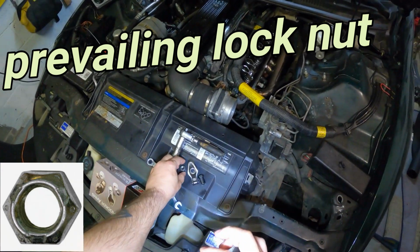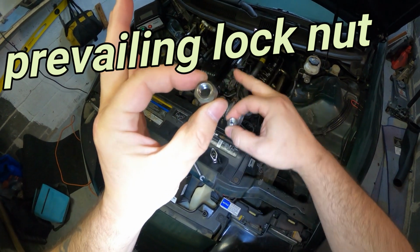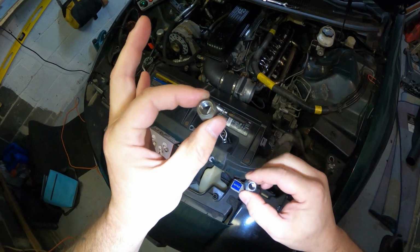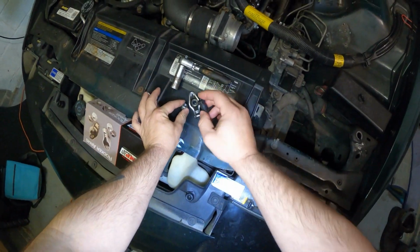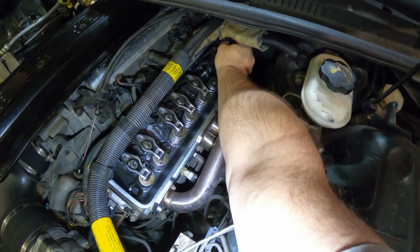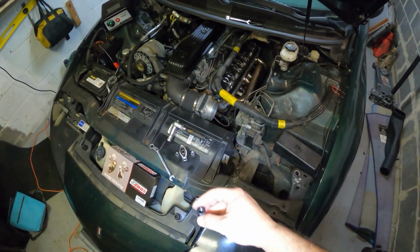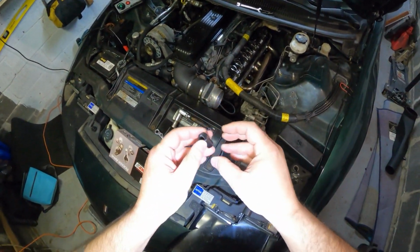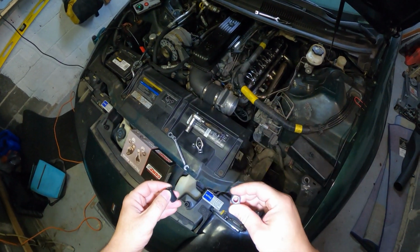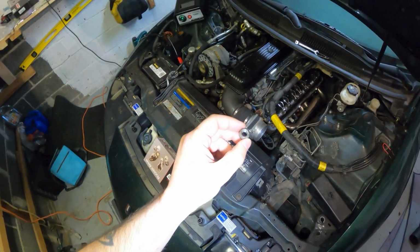Well, in my case, I reuse the factory nuts from the old rocker arm setup for the new rocker arms, primarily for convenience, because if you use these poly locks, it's hard to adjust while in the engine. So it's just convenience, and for a moderate cam in this setup, these type of nuts work just fine. But they do wear out. So God knows how many miles are on these nuts.